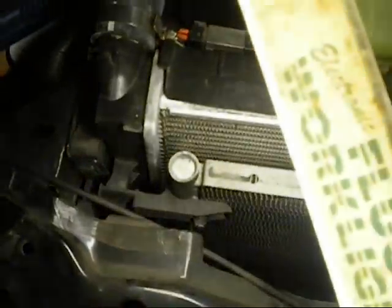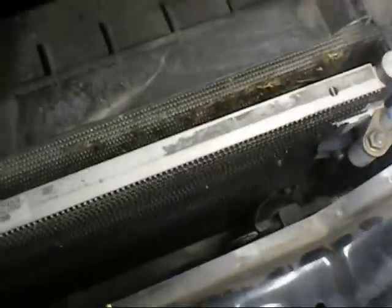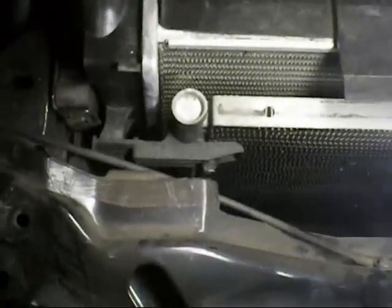The cheap bastards have turned the plastic tanks on the radiator into condenser supports. So it's going to make it more fun getting the radiator out without degassing the aircon, which I assume is doable, but I haven't done one of these before, and I'm just like, you fuckers, as soon as I saw that. So I've got to reach in, and the clip at the bottom's what actually holds it in. So I've got to reach through the bar and unclip it and lift it up and swear at it a bit without degassing it. Damn thing.